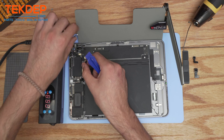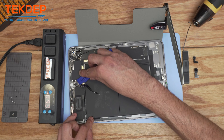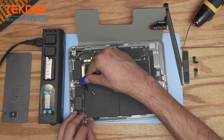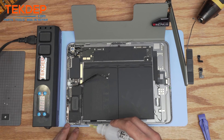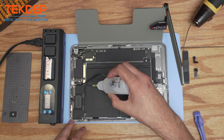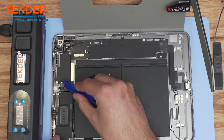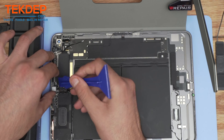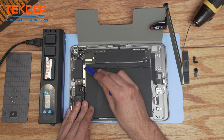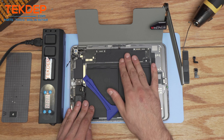These are the coaxial cables for the antenna, and there is also the connection for the top loudspeaker — very tiny connections, so be careful and gentle. We can also work on the top speaker. The motherboard is an L-shape, so there is also a connection on top. Once you see that all the connections have been taken out, the motherboard can be extracted.